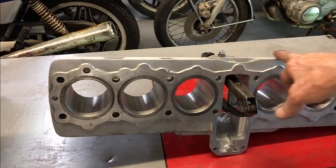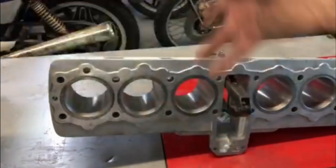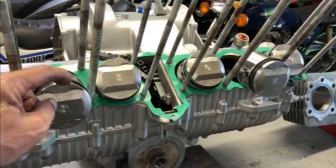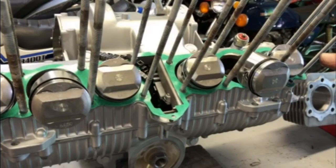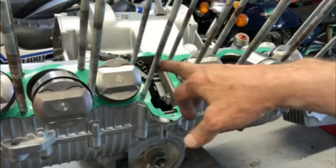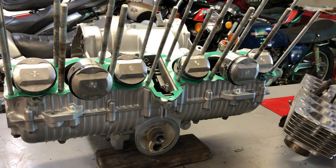I have not painted these cylinders — they came really clean, so I'll go ahead and install them and then paint them when I repaint the whole engine. We're pretty much ready to install the cylinders now. Rotate the crankshaft so that number two and number five pistons are at top dead center. When you lower the cylinder down, those two pistons get started first, and that helps support the cylinders while you install the remaining four pistons. Also, have your magnet ready so that while you're putting the cylinder in, you can grab hold of the cam chain.